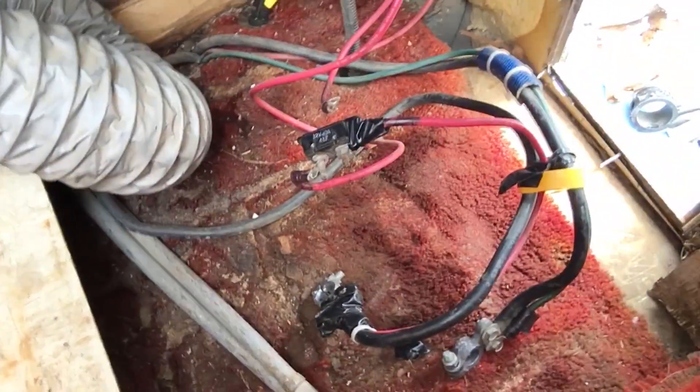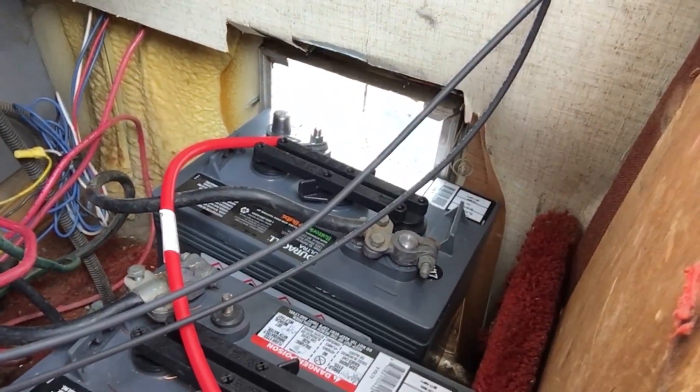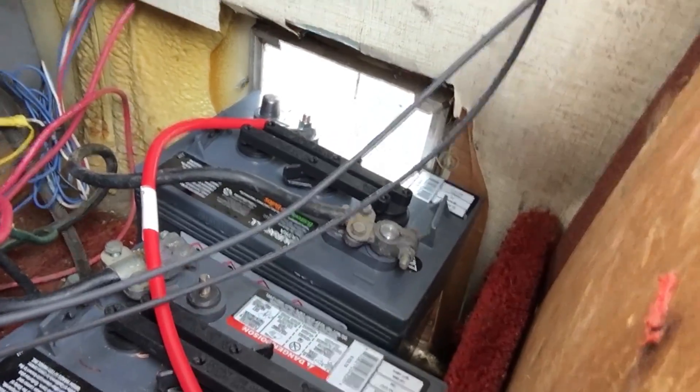We're working out which cable is the 12-volt feed-out, since everything needs to come out through the load ports on the solar charge controller. In an old van it gets confusing — one cable is probably a feed-in from the alternator for a split charge. These batteries aren't fully sealed like leisure batteries you'd buy in Europe; they have full venting requirements. There's a vent hole at the back which we'll make sure stays open, and then the battery area will seal off.